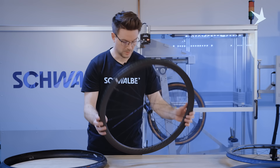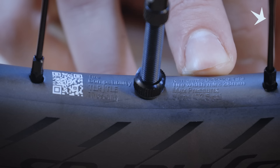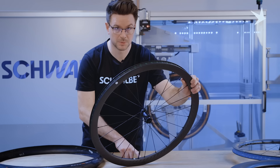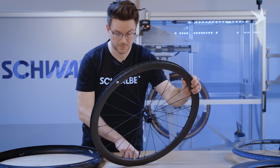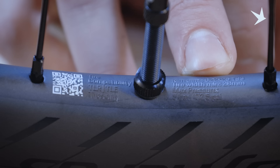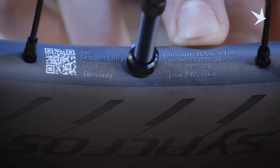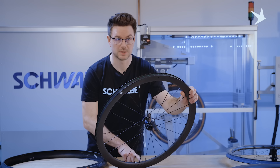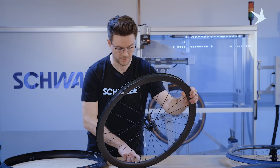So if the indicated pressure of the wheel is lower than the indicated pressure of your tire, you will have to use the lower value for your tire pressure. Usually people ride too high tire pressures anyway, but this is the maximum pressure you can inflate into your system. You will see on the wheels that there is an indication of what kind of rim it is — usually the inner width, a minimum tire width, which tires are compatible (TLE or TLR for tubeless easy or tubeless ready), and also a max pressure, often 5 bar. This hookless design rim usually has a maximum pressure of 5 bar, which is the ETRTO standard for hookless designs, while hooked type rims can go higher in pressure.